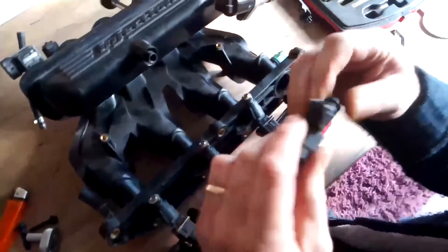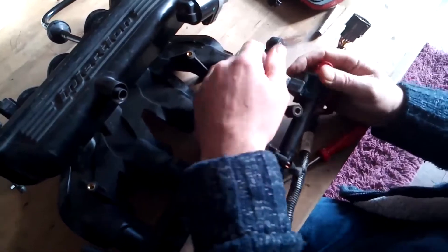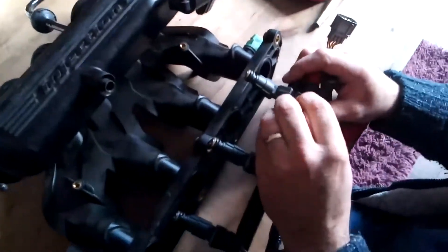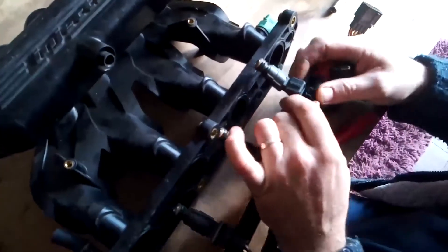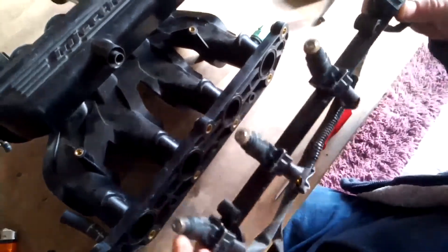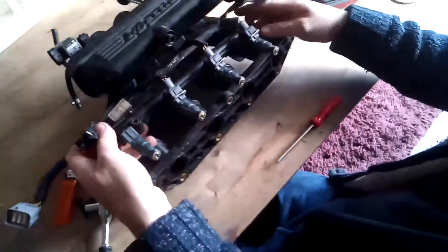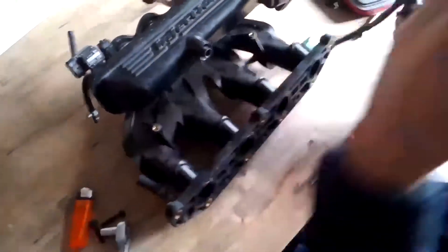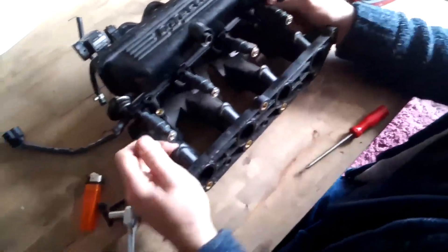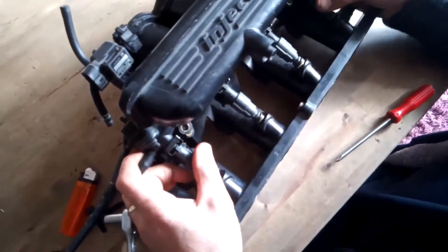Other than that, we're then going to put it back in place — just slot it back into the fuel rail, get your little clip that slides over the top. We put it back in reverse order: slide it back over, and put it into the slots where the injectors sit. Make sure all the rubbers are sitting nice.